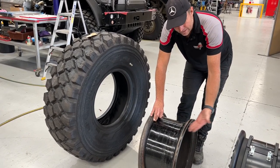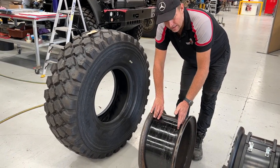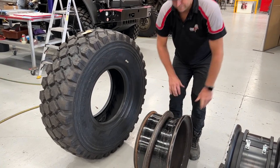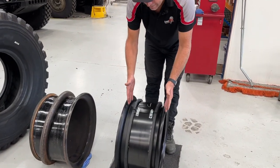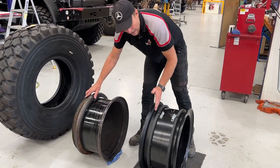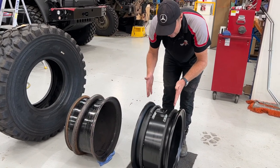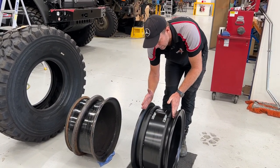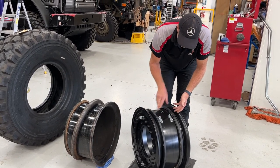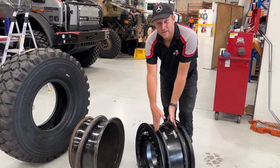When you are off-road — in sand and mud and rocks — if the tyre is loose in there, you get a lot of debris down the side of your tyre, and best case scenario your tyre's going to go flat and you'll have to repair it on the side of the road. When we come over to the Hutchinson, we have a positive bead. You've got one inner bead and one outer bead, and this part here is removable. Your tyre comes in and sits in these positions. As we do up the nuts on the outside of the rim, this clamps up, squashing your outer bead, your beadlock, and your inner bead all together — so you can go down to pretty much zero PSI and you will not be able to separate that bead.